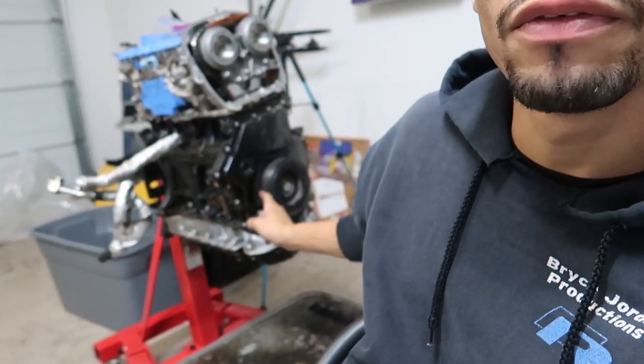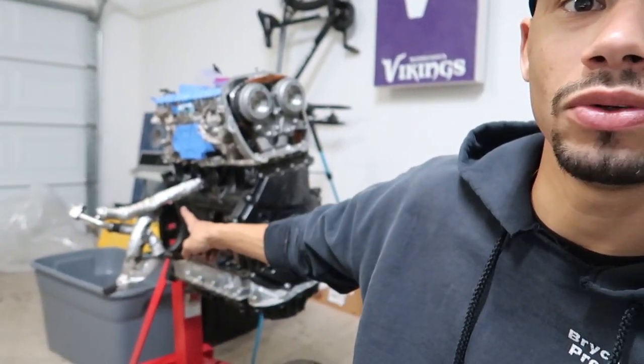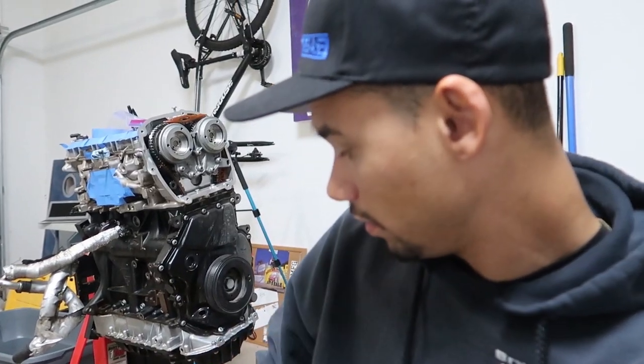Next video, we'll start off with the crank pulley. Get that lower cover off here, flip it, get the pan off, start on the timing chain guides and chains and the oil pump chain, and then try and get these damn hoses off the back. I'm gonna spray them down with some more PB Blaster. I tried to yank on them a little bit. They weren't coming. I really don't want to destroy them.